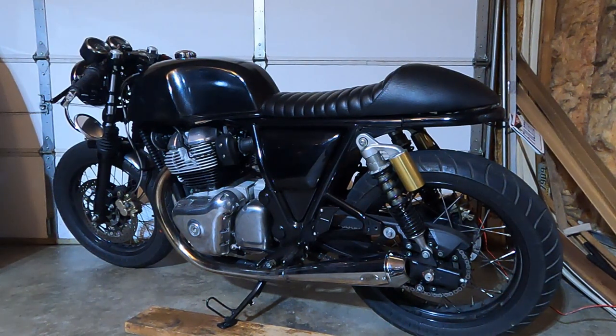And I'm like, well, if I didn't have to do that extra shift, I would be able to cut my time down. And also, first gear is worthless. It's basically immediate redline. So I decided to get a 16-tooth sprocket. And you're saying, dude, how's that going to make you faster? What kind of crazy person thinks a 16-tooth front sprocket, which is going to make your gears taller and lower your torque, is going to make you faster? Well, my thinking is, I got the engine upgrade, so first gear, I can make that taller. Second gear, I can make it taller. And maybe I won't even have to shift in the third to get into the 60-mile-an-hour range. And then maybe this engine can just push it, and it'll improve my times.